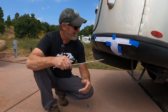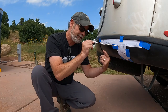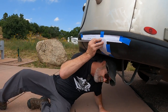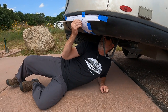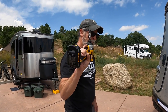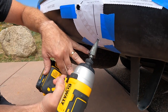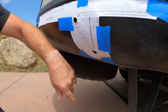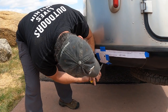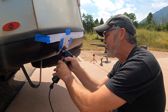I'll take a steel rod and slide it in here. When I straighten it out I can feel it on the frame, and I'm going to line it up from the inside and look out — just to make sure. Once I'm satisfied the holes are in the right place, I'm going to take them out to about a half inch with this step drill. It doesn't stop you at a half inch, so you're guesstimating — it doesn't have to be an exact half inch. When the bumper goes in there, the slot disappears. It could be done with a jigsaw or a reciprocating tool.